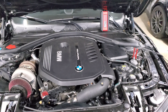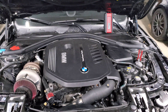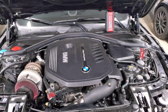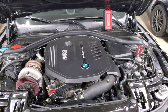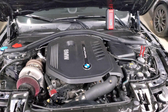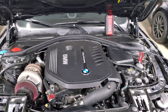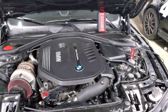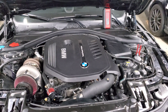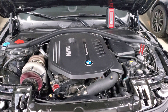For example, on my car when I did my E85 tune it was actually around 80 to 82 percent, so I could have called it an E82 tune, but I just said it was pump E85. Others are more specific with the actual ethanol content — that's all it really is. E50 is another common one because people want to hit their target ethanol content regardless of which E85 pump they encounter while traveling. Since pump E85 can be as low as 51%, an E50 tune is a safe buffer — if the pump E85 is only 60 or 70%, you can mix down to your E50 target.